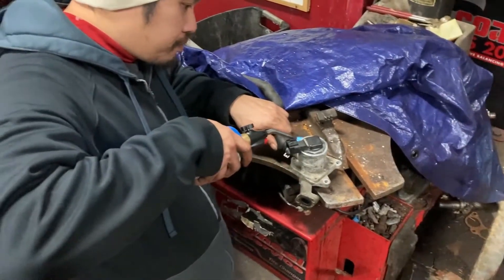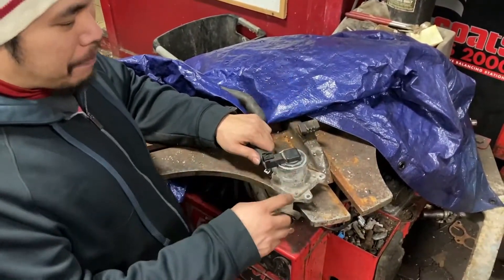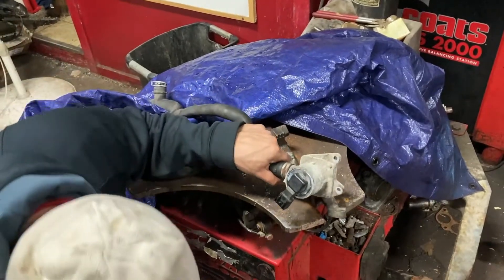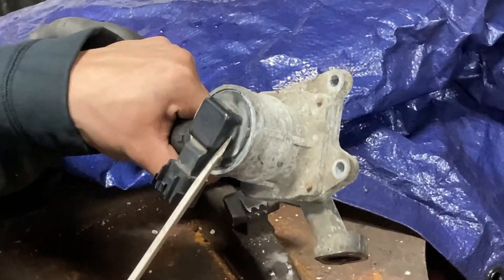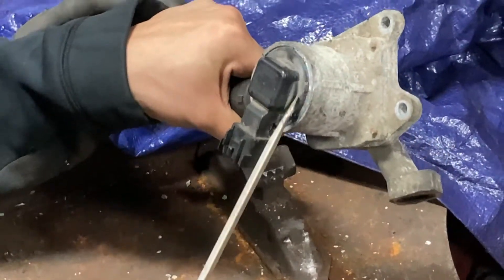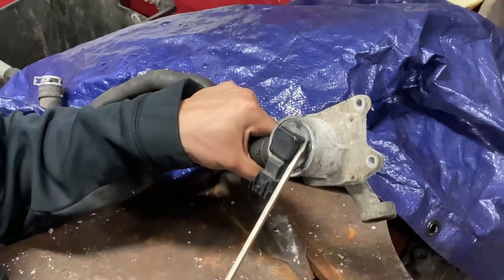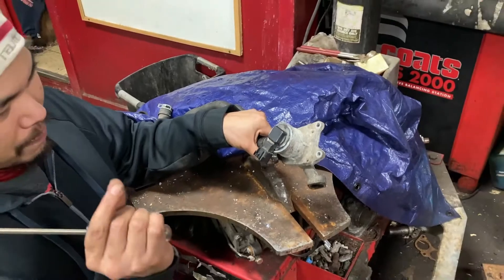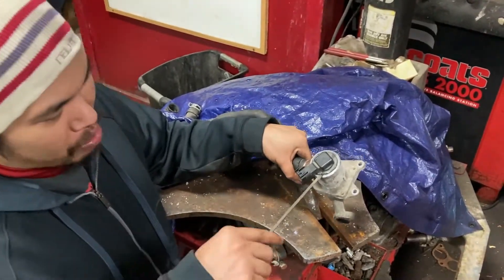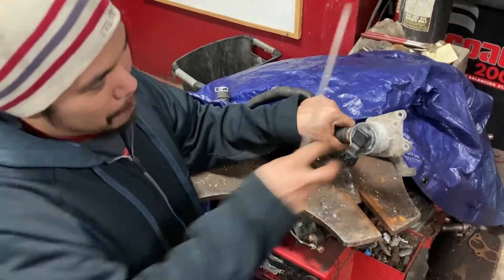So you just keep heating it up and go around it. What we don't want to hurt is anything that you see raised — you see this raised spot right here? This part right here is all flat, that's just like regular flange skin, it doesn't have any electronics in it. But anything that's raised, like the circle right here and this big square box, we don't want to mess with that because that'll ruin the sensor. We want to try to get as much skin off as we can, and right in the center there's a little metal pin that holds it down to the body — the rest is glue. Once you get all that off and get a little bit of prying angle on it, you can start working that pin off and it comes up. Get it from here up and out, we're good to go.